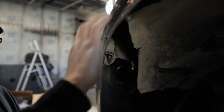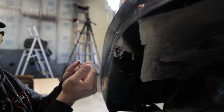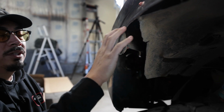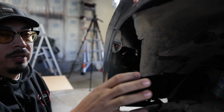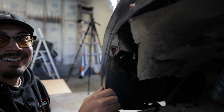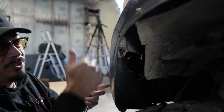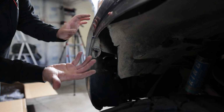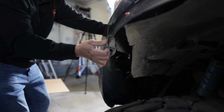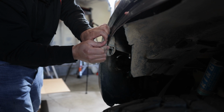All right, so on your Tacoma, you're actually going to have a wheel well right here, and there's a plastic trim, which you're going to have to release. I've linked the video in the description box below where I've removed this in the past. So if you want to watch that video really quick on how to get to this next step where we're at now, you could do so. But we're going to go ahead and skip that, of course, since ours is gone. So the next step, you're going to want to go ahead and get your fingers and just literally pop this away. It's held in with some clips on the fender here.